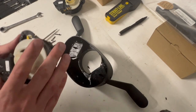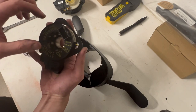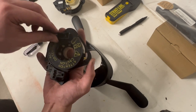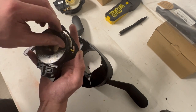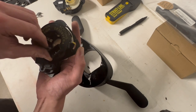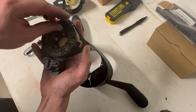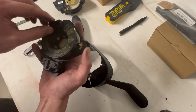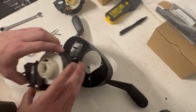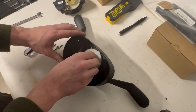Second, and most importantly, make sure your clock spring is wound the correct way. I did that by rotating it all the way until I felt it lock out. I went the whole way back — one rotation, two rotations, three rotations, almost four. That means I need to go about one and three-quarter rotations back: three-quarter rotation, and now I know that's the center. So now we can turn this around and place it back into our SIM.